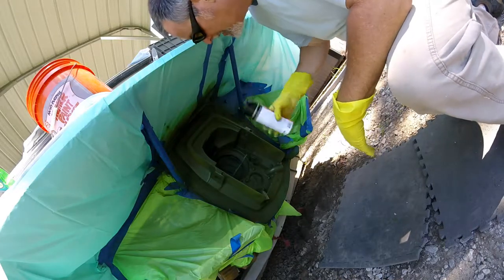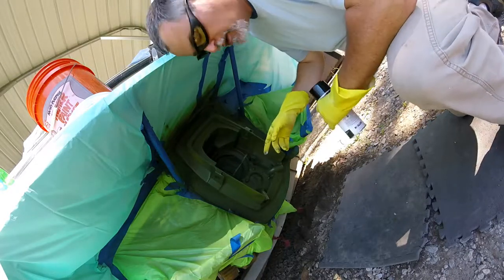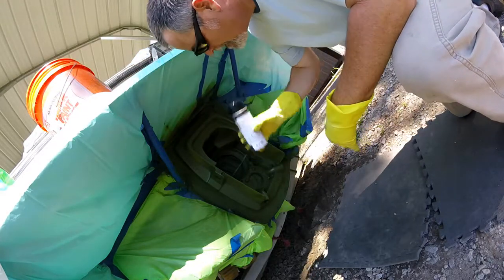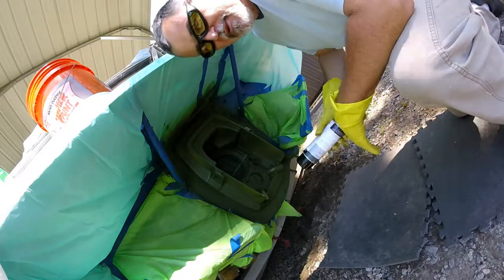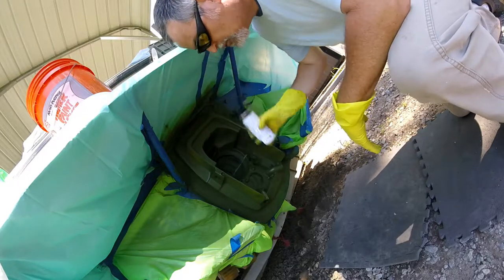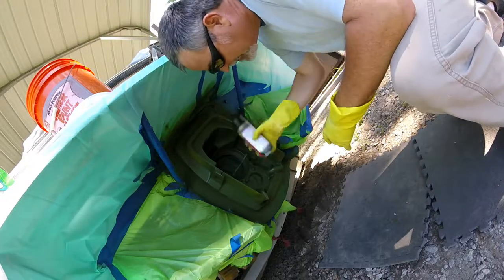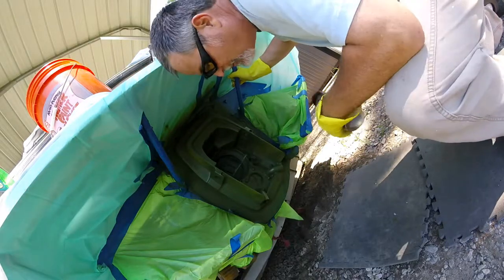It's time to put some real paint on. The last coat of primer has dried over 24 hours. Make sure you read all the directions — some things take longer to dry than others; some the first coat could be 48 hours, then 24 after that. Keep an eye on your humidity. It's been very humid here in Virginia, so I've had to paint at different times of day — I had 100% humidity and waited until it got below 60 percent. I'd suggest wearing a respirator anyway; why breathe fumes if you don't need to? Make sure you shake your cans well and use thin coats — multiple thin coats. You don't want orange peel or runs.